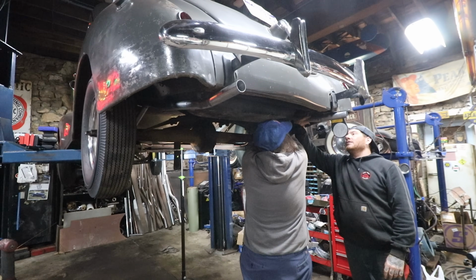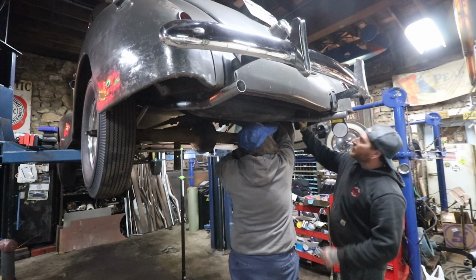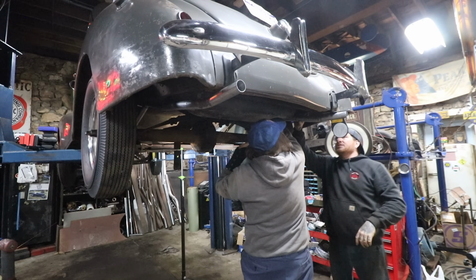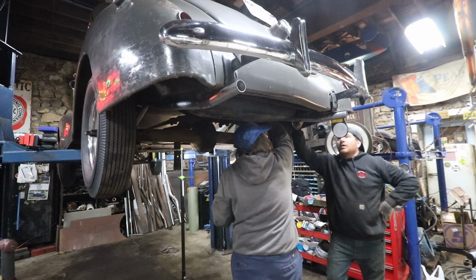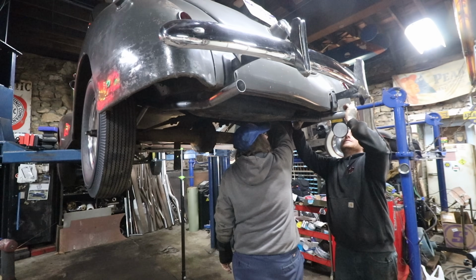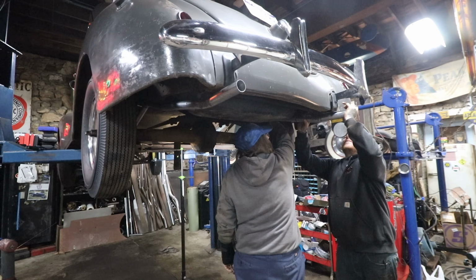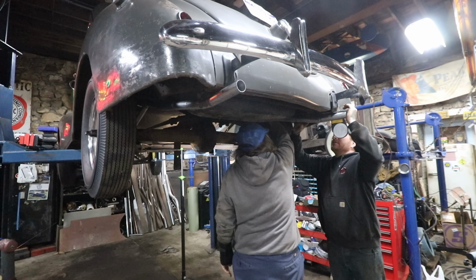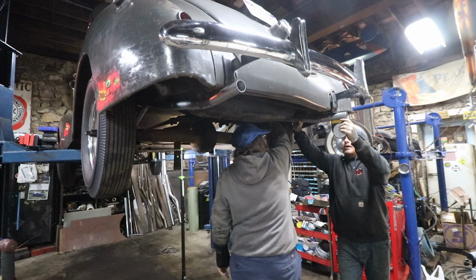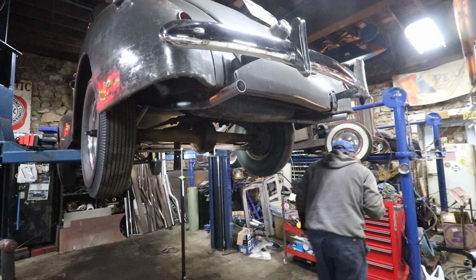So this one here didn't close up at all though. I mean, this one here isn't even bent. I can still see the light straight through it. Oh, you're gonna see light because it touches in the center and won't touch in the sides. They're pretty much touching, but as you weld, they will close. Maybe when I close it like that, there you go, now it moved. We're getting two, so when I weld them, you're probably gonna gain one each. That puts us right in the vicinity. All right, so I'll weld them up. That'll probably get us basically what we need.